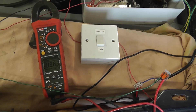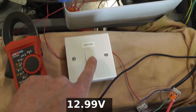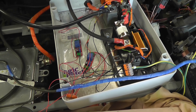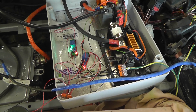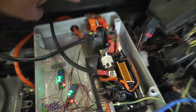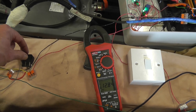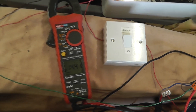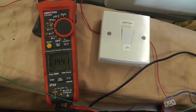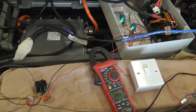Let's reset our meter — as you can see the battery is currently at 12.8 volts. The same two relays operating the same way to send the voltage through: first relay, second relay — that should be 350 volts now coming into the DC side. As you can see we're sitting at 12.8 volts, but as soon as I flick this switch it goes up to 14.4 volts — that's the full charge voltage. That's it, it's working! What I now need to do is figure out how to get the AC side of it working — so that's got to be next.